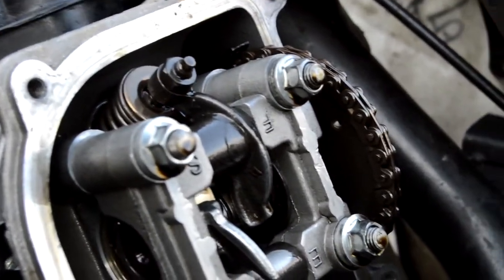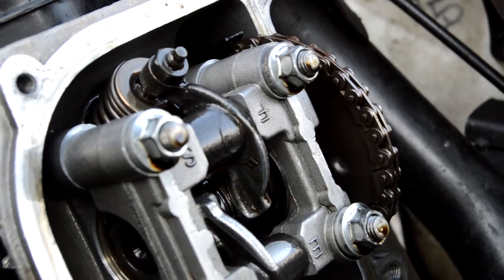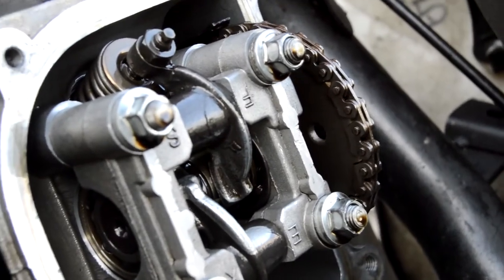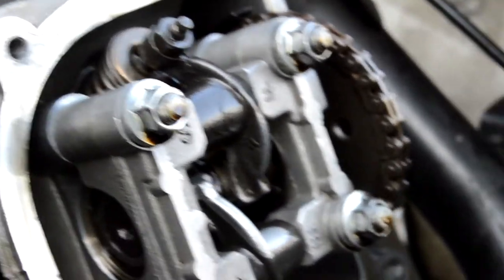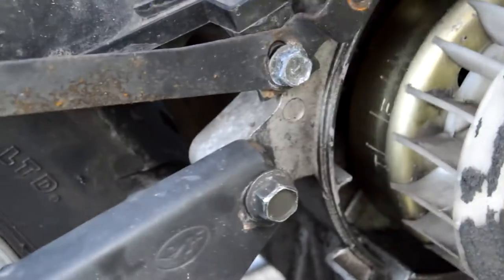Okay, you see it? That's the top hole. Do you hear it decompressing? And there you go — there it is. That hole right there means you're actually at top dead center. Come back up here and check it — top dead center. It revolves twice, so make sure it's always like that.